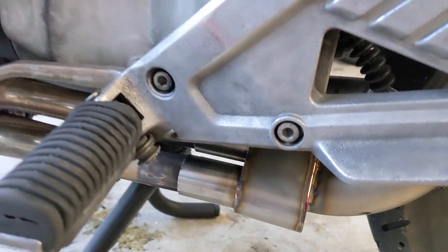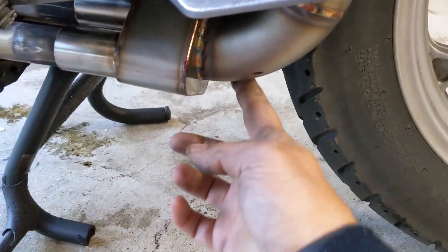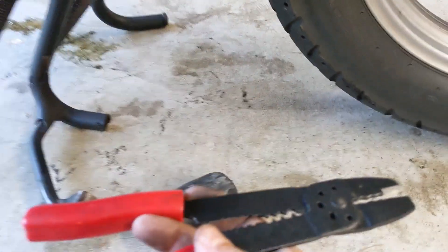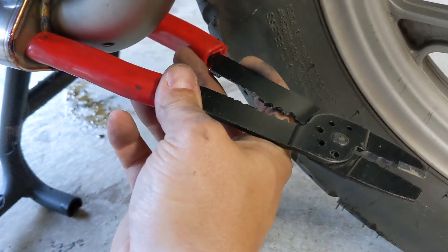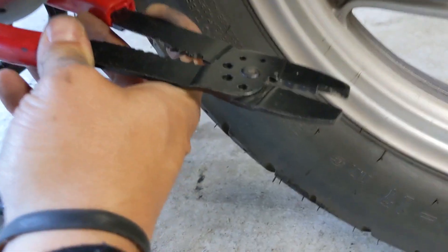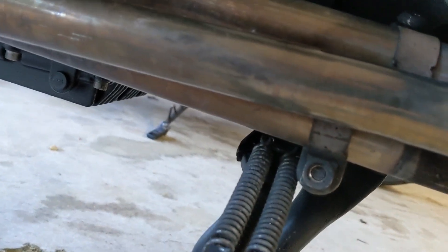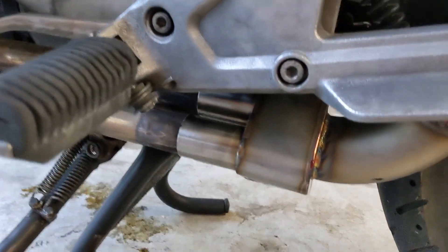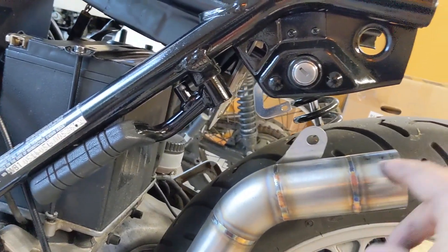Using a rubber mallet on the ends is helpful. As odd as it sounds, these wire strippers — they've got a nice rubber handle bottom — I can place them on each side of this diamond-shaped four-into-one collector and just tap on the end to get a nice even push across all four exhaust manifold pipes. I'll continue to gently snug that up — the fitment is coming in nicely.